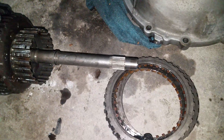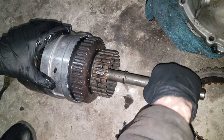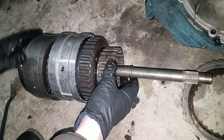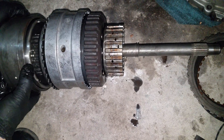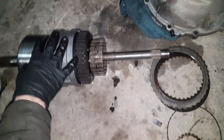There's actually not a drum on that so I can show you reverse gear. But essentially how this transmission works is you can spin it from the input shaft. And there's usually a drum here. Whenever you get the drag on your transmission, this is caused by the brake band. So this kind of slows you down when you let your foot off the pedal.